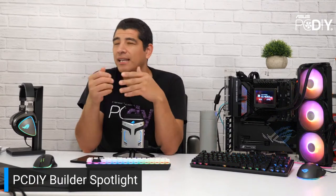Let me go ahead and just see if I've got some notes right here from him that he sent over. So yeah, he had an E5 2680 V2, and then he was running DDR3 2400 C10. He was, of course, running that at a lower speed, 1866, and that's due to the memory controller being locked on the Xeon platform. You didn't have that prior to using the Xeon, he was actually using a 4930K, so that's why he had faster memory present on there. And then he had the full EKWB kit for the water cooling setup.